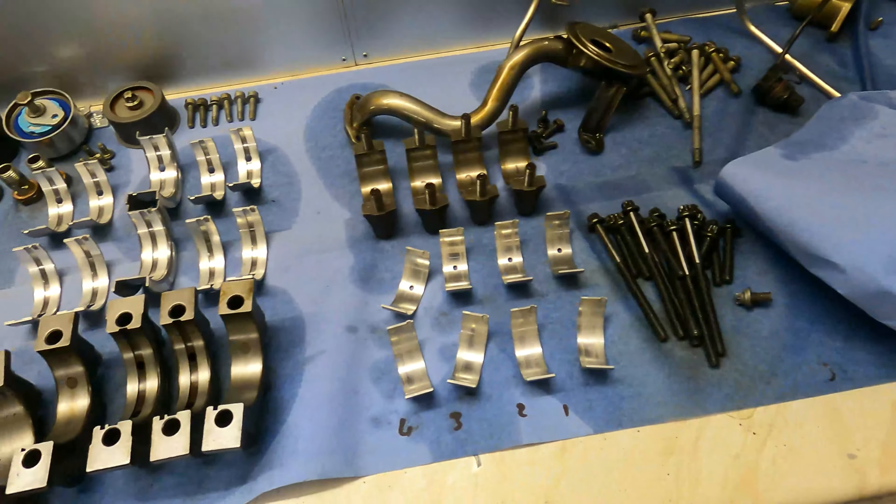The other job we noticed last time — when I pressure washed the gearbox originally, it must have had a little bit of water left in it because when I went to take the driveshaft out, there's a bit of milkshake in there. So I'm just going to drain that out. I've got new oil to go in. That's the gearbox oil all out — there must have been just a little bit of water left in there from when I pressure washed it, making the new oil go a little bit milky.